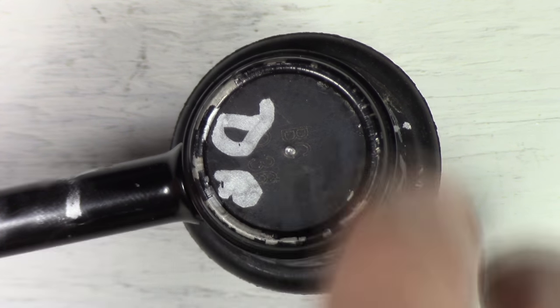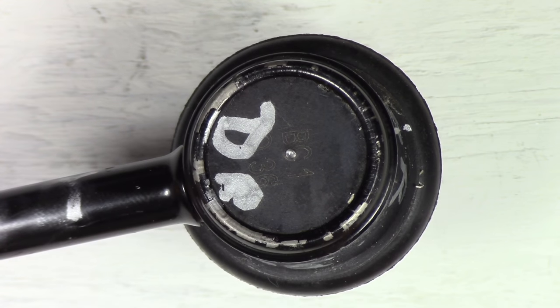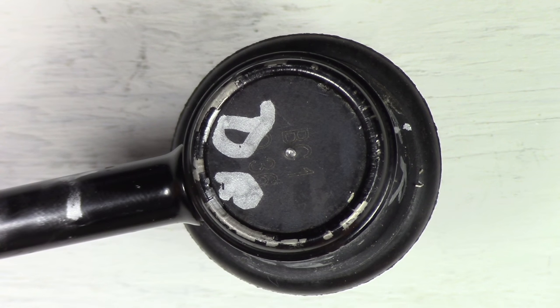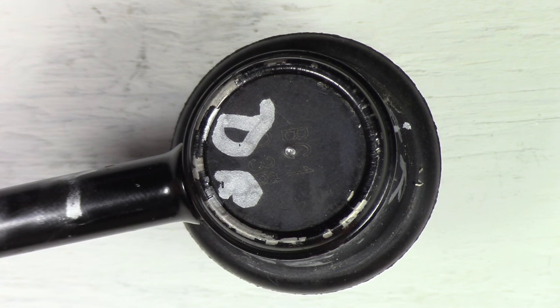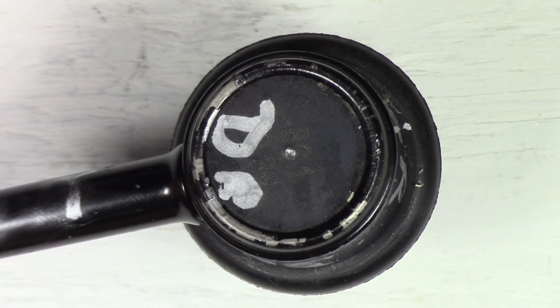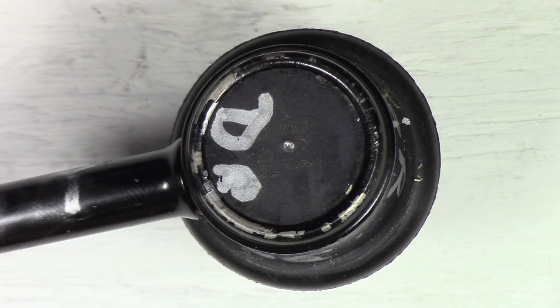After we're done that, we're going to go to the drill press, drill out a small hole as a pilot hole, and then slowly build the hole up, or drill the hole out until it's a 7/32. I'm going to start with a 1/16 drill bit and work my way up. I'm not going to use every single drill bit on the way up there. Probably skip two or three sizes until I get to the 7/32 drill bit. After that, we're going to tap it out, and I'm going to use, like I said, the drill press to do that. But you don't need to.